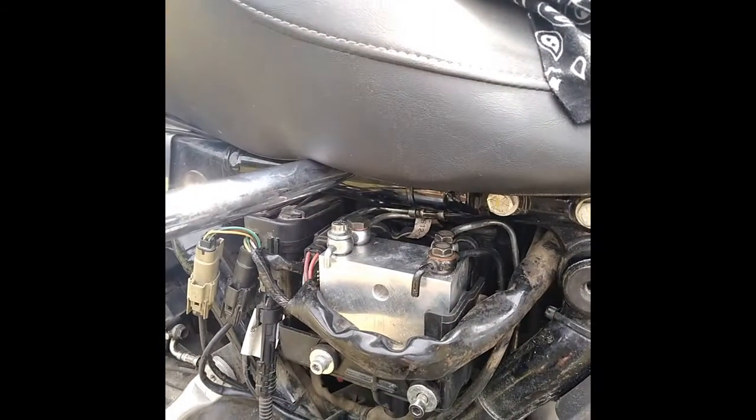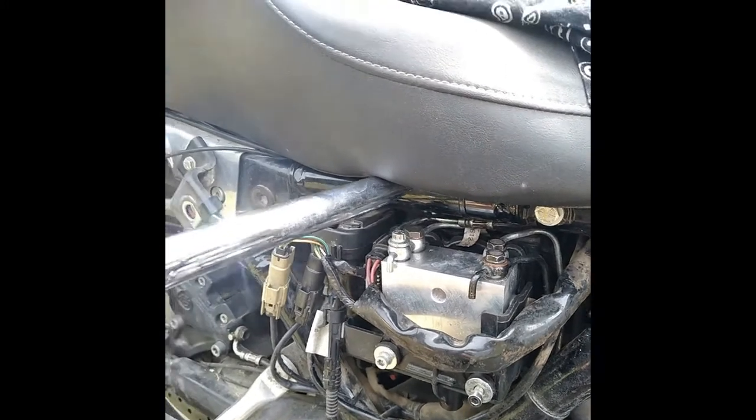You'd never really need the ABS function unless you took the valve body off and totally drained it. You don't need the ABS function to suck the brake fluid out and put new brake fluid in — because you're just moving brake fluid, just using your vacuum sucker to suck brake fluid. You just keep filling it up so you've got clean brake fluid coming out the backside.